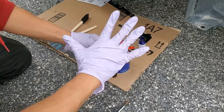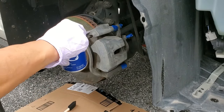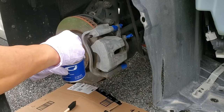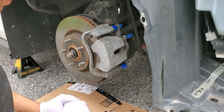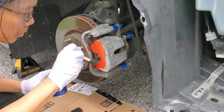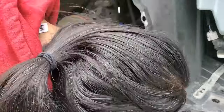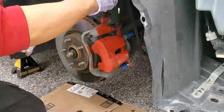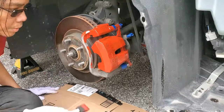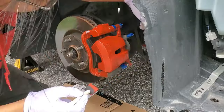Now I'm going to wait five minutes and then mix it again. Once I start, I'm only going to film the front passenger caliper because I don't want to risk getting paint on my cell phone. Once I'm done with that one, I'll work my way clockwise around the car. You're supposed to wait 15 minutes between each coat, so by the time I come back to the front passenger side caliper, 15 minutes should have elapsed. Also, if the brush you're using starts to deteriorate, swap it out — otherwise you'll get little bits of foam stuck in the paint.